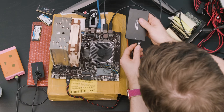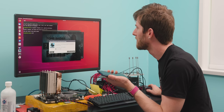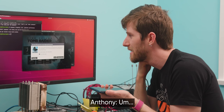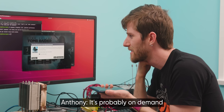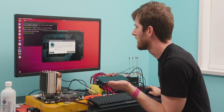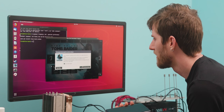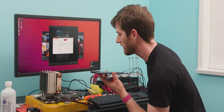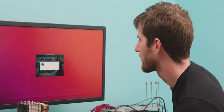After hot-swapping to an SSD, I tried to launch Shadow of the Tomb Raider. The pre-launcher warned that my current active CPU governor is not optimized — they're probably recommending performance mode for full throttle. Then it said my graphics card or driver is not supported. But actually, very good news: my graphics driver did install because I'm now running at 4K 60Hz — which makes more sense for a 1050 Ti — and HDMI 2.0 is working. The game still didn't like the CPU governor, but I continued anyway.